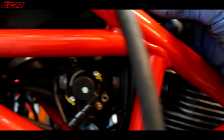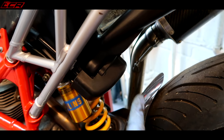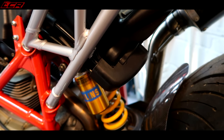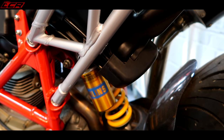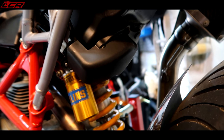So it actually seems, I don't know if you can see, but this fuel line has been clipped on at the factory with these clips which you can't basically remove, you have to cut them. So perhaps it's going to be better after all to disconnect the fuel line at this end and leave the lines connected to the throttle bodies. I can cut those clips off if I need to remove them and then Jubilee clip it instead. But I think it's going to have to come off here.